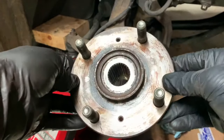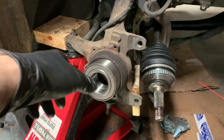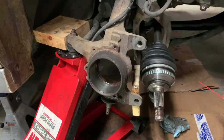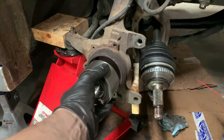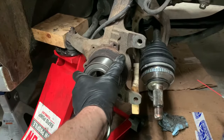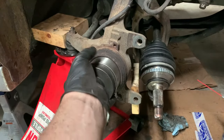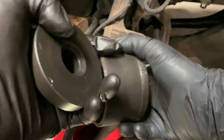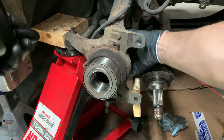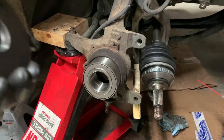I've taken the wheel hub, sanded it, lubricated the proper spots. It's nice and smooth and ready to go back on. First, of course, we have to put the bearing back. I even wiped down the spots where I did put the high-temp grease — I just want it to be dry. You're just getting it started and it'll push in there. Now with the flat surface, get the washer that matches as close to the outside diameter of the bearing as possible without actually going over it. In the back, we're going to take this and it goes into a specific little slotted groove where it can't come in contact with the bearing. Then we'll get our little bracket back up there and start pulling it through.